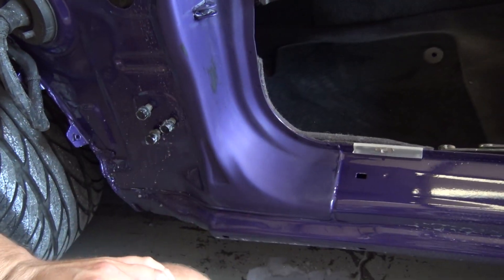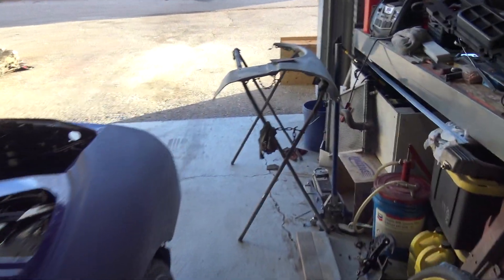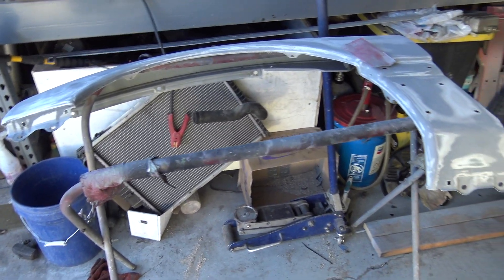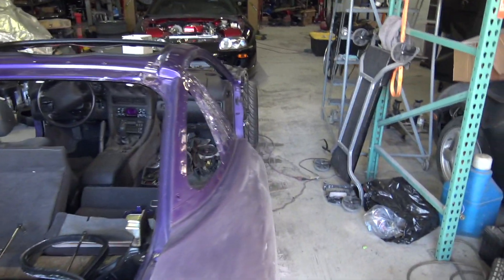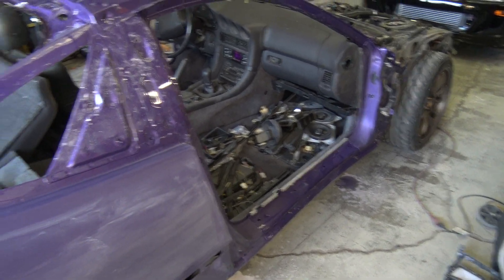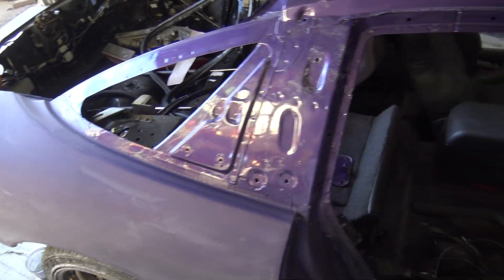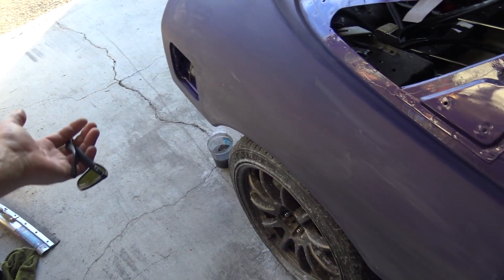This is my first paint job so I'm learning as I go, and these little sections aren't really a big deal. I sanded this fender down — I was thinking about hi-build primer today but decided against it; I'll probably do it tomorrow. I noticed a few areas I missed right there — there's a little shiny spot I need to scuff a bit better — but otherwise it's pretty much ready to go. Either tomorrow or the next day I should be able to repaint these quarters and the scuff spots, then clear it, and I'll be good to go.